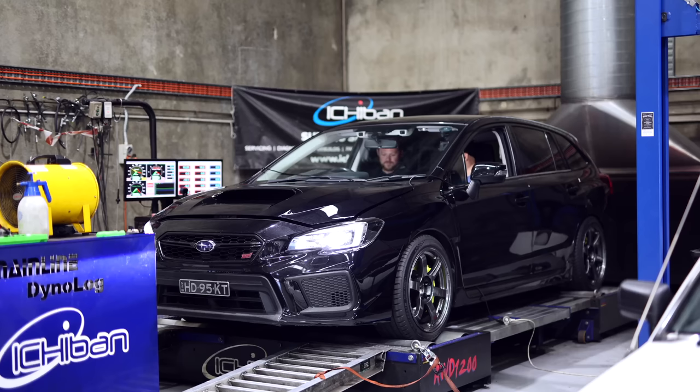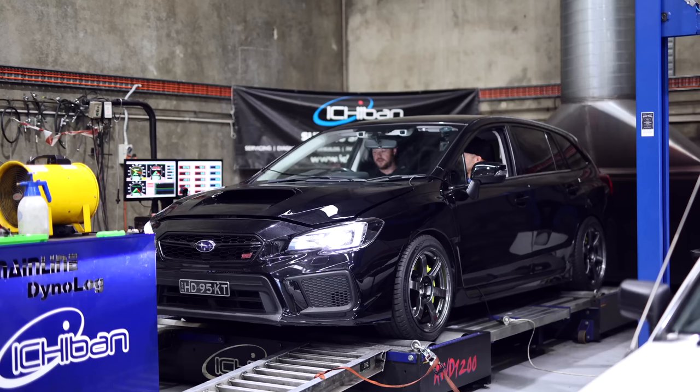Okay. And so this is maybe where people start thinking about ethanol, which you could. I've chosen not to do it because of the stock turbo. Usually ethanol, we find, will make a 15% gain if you go same boost, but with ethanol, we can put more timing in it because it's got higher octane and burns colder. We'll just pick up 15%, and we'll be in the low 200s at that point. On a stock car, 190, so round numbers 200 kilowatt, you'd usually pick up 10, 15, so you'll be 220, 230. Okay, cool. But then you'll use more air because it comes on earlier. So it's a give and take.